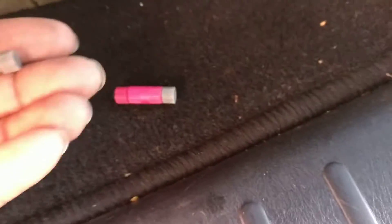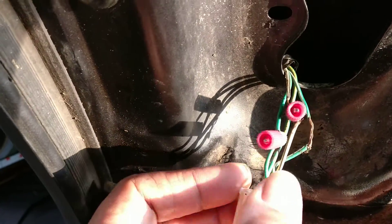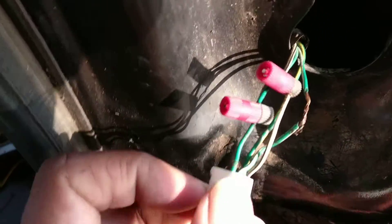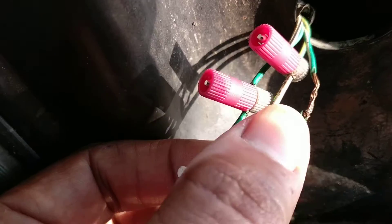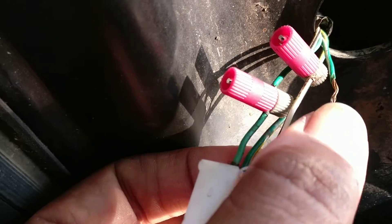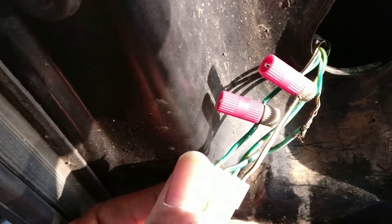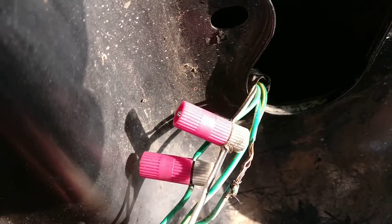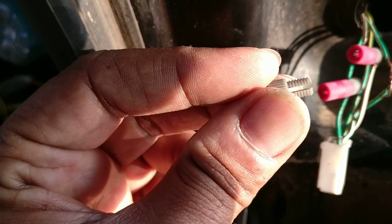It is used to tap into an existing wire. In this case, I just opened up the wiring of my rear tail lamp. The wiring was not good enough, so I removed the existing wires. The traditional way a mechanic does it is just splice up the wire and take a tap out of it to power another gadget or device. This is not a very good way. With Posi-Tap, you just insert the connector into a hot wire.